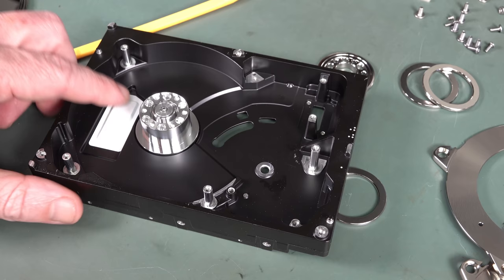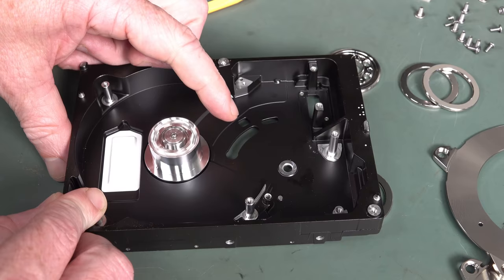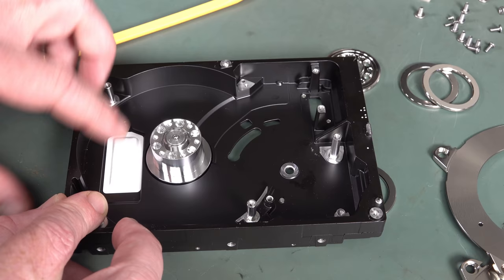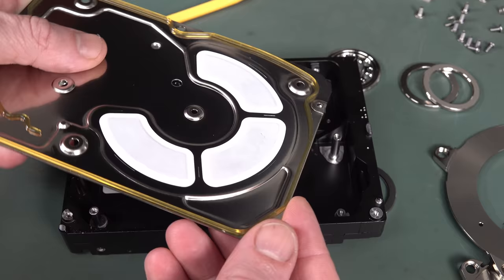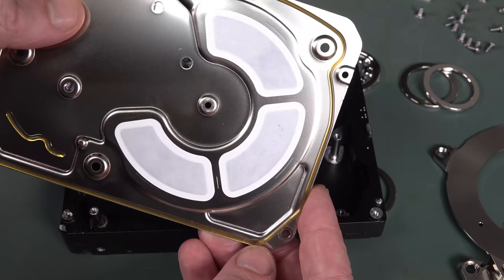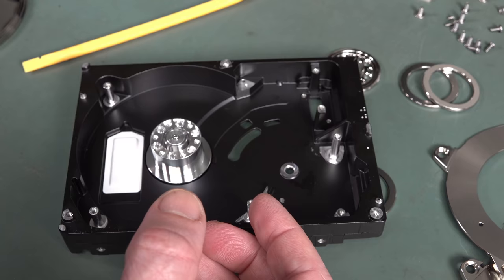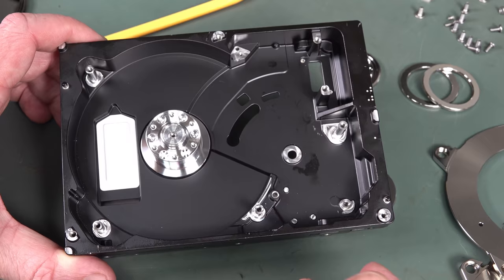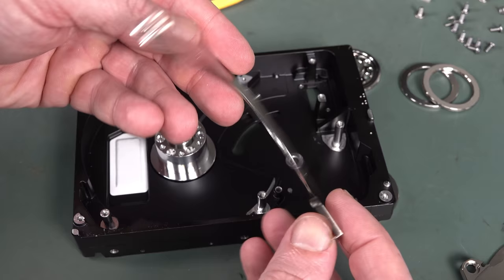And we've got another pad under there. I don't know. Is there some aerodynamics to that? There's actually a significant amount of friction in that. I guess, once again, that'd be precisely engineered. There'd be a reason for that. These pads would be for aerodynamic reasons, to keep the platter from flapping around in the breeze or whatnot, I would guess. Or if it happens to wobble a little bit, maybe it touches the pad and doesn't touch any metallic surface so it doesn't get damaged, because they obviously don't need those in the middle. They don't need those around these at all. But yeah, these would be precisely engineered.